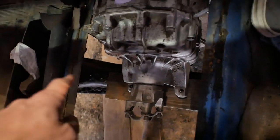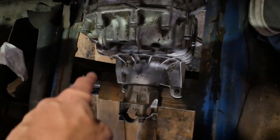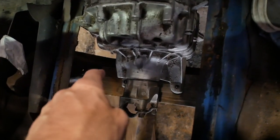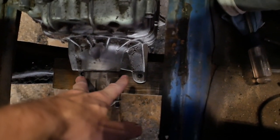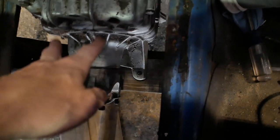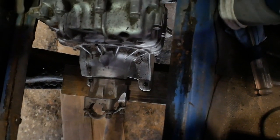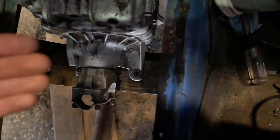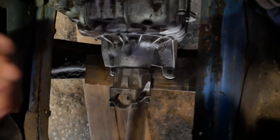The actual transmission mount, currently you can see, is a lovely piece of dead tree. It is on the original truck's crossmember. This is not the crossmember out of the 96 parts truck. This is the crossmember that was holding the NP435. It will accept the two holes of the transmission with a mount, but not the mount from the original ZF5. That mount is too tall, and it had the transmission sitting too high, which puts the drive shaft up into the cab and chassis of the truck.